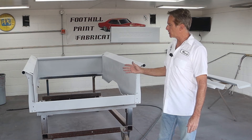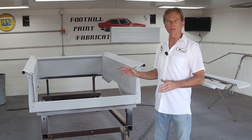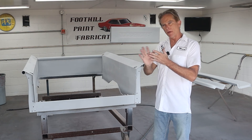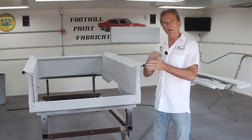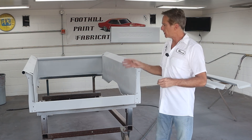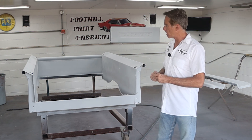Finished shooting. I double coated the spots that had body filler or heavy work done on them. Once you put one coat down and it starts to flash off, you can actually look and see those areas — not that they're low, but you'll see a little halo or a different sheen from the body filler versus the old paint. So you go back and put another coat over that to give a little extra material to sand in those areas, in case there are sand scratches or a little low spot. I got a good solid coat on everything.